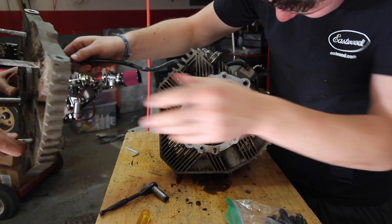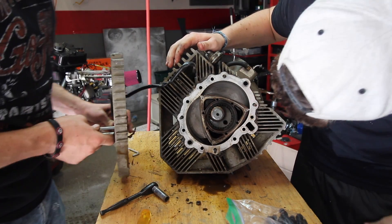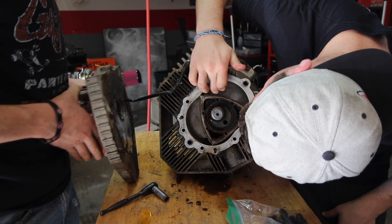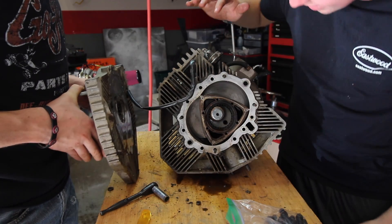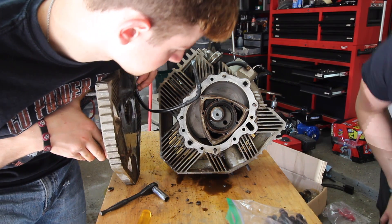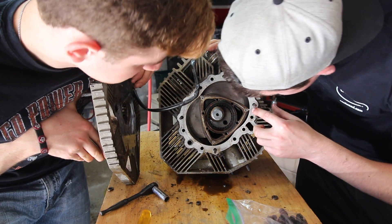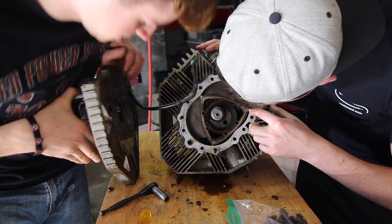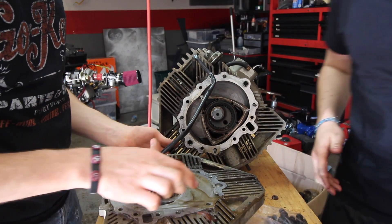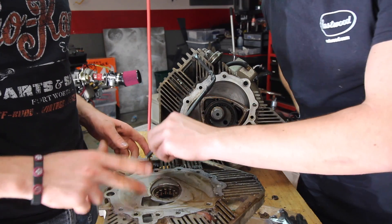Look at that — wow, that's a huge rotor! The surface is like butter. I'm so glad we tore this apart. This actually looks really solid. Look at the apex seals, and the cylinder walls — I don't know if they're close to worn, but whatever, the walls look great. Oh, barely anything worn.